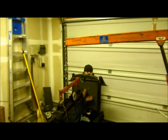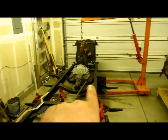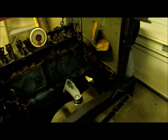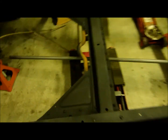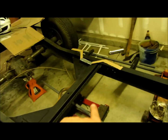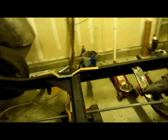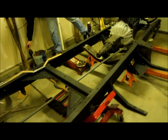We're all about building crossmembers — one way or the other, we're going to build a crossmember. So we cut this middle one out to fit the bigger bell housing, notched that one to make room for the fan belt, and now this one we're just going to have to notch and bring down a little bit. We're going to take the parking brake cable assembly out. Maybe we could get away with cutting a round piece of pipe and welding it in just to make driveshaft clearance. If not, we'll build another crossmember that has the clearance. And when we notch his frame — because he's going to go with a tail dragger kit — we'll put two crossmembers in that as well, so the frame's not going anywhere.